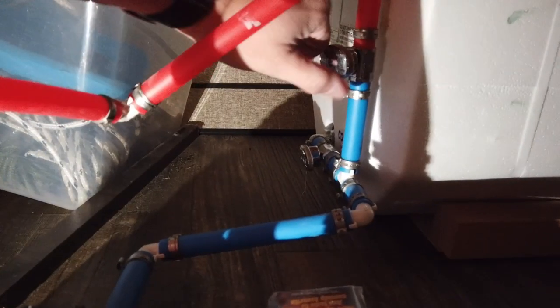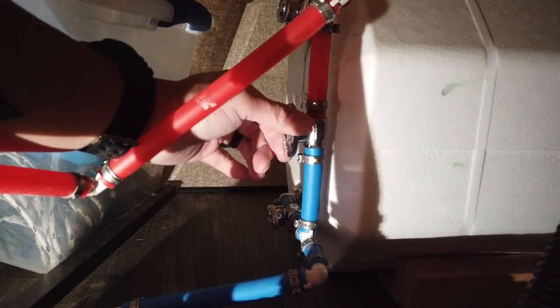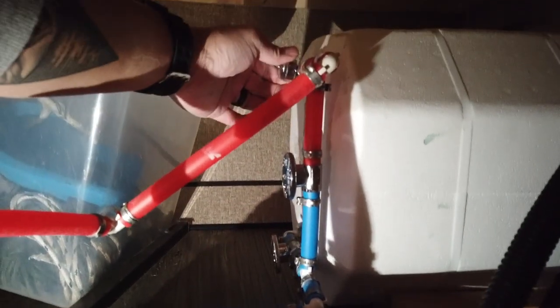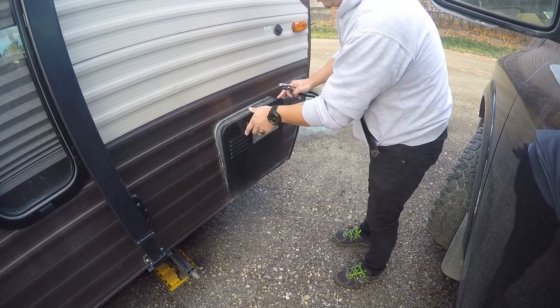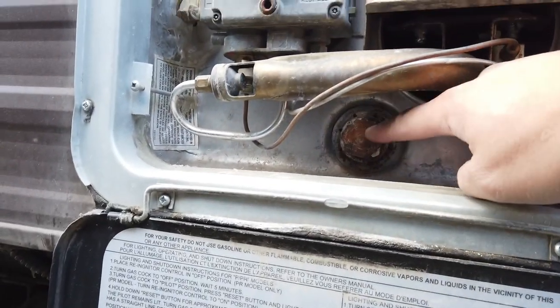So essentially what I'm looking for are the valves so that I can bypass the hot water tank and circulate the water directly from the fresh water tank. I close off the cold, and then I close off the hot, and I make sure that the cycle is on. So I then head outside to access the hot water panel, and I'm going to take this piece off,